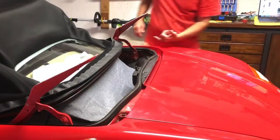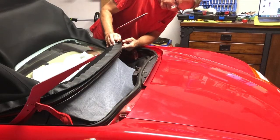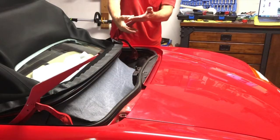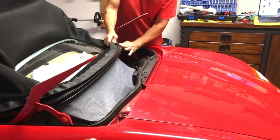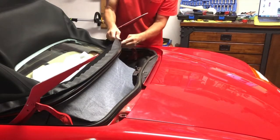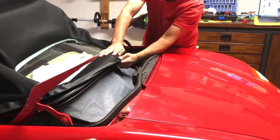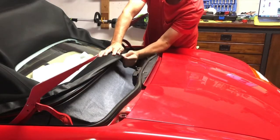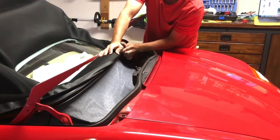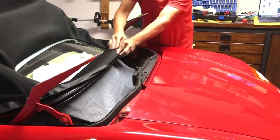Next, I'm going to take some 1/2-inch two-sided tape, and in this large channel under here, I'm going to stick the tape kind of up in the upper part, and then I'm going to use some spray adhesive, I think, actually, on this and the underside here. And what'll happen is I'll pull all this around, the spray adhesive will do its trick, and then this last little piece of cloth will tuck up in there onto the two-sided tape, and that'll be our finished edge at that point.